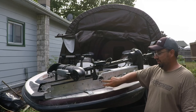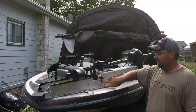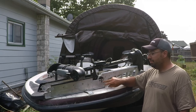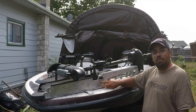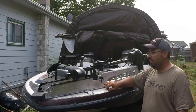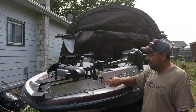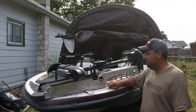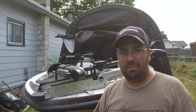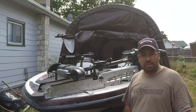If these bolts are loose or broken off, replace the screw. You can actually just get the same one at your local Lowe's or hardware store — just take one with you to make sure it's the same size, if you don't have time to wait for Minn Kota. I got this one from a Minn Kota dealer and it's stainless steel. Hope that helps. I'll grab the camera and show you up close exactly what I'm talking about.